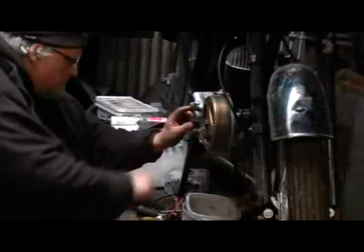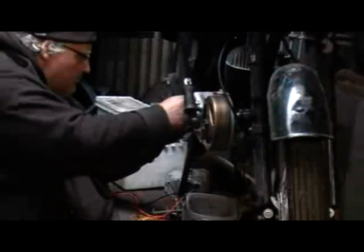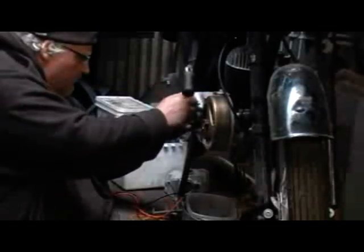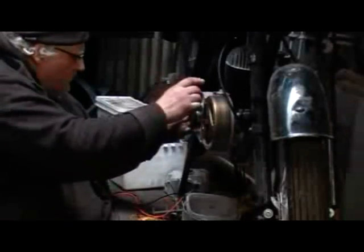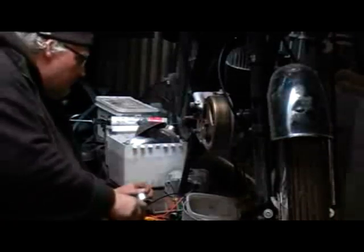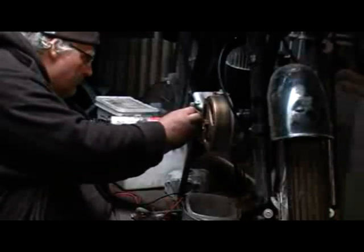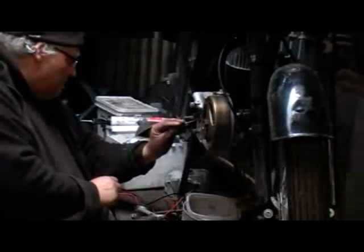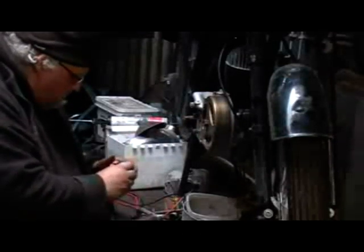That just leaves the kickstart spring. It's straightforward — you just put the spring in. There's a series of holes in the casing that the tang of the spring can go into. Usually just start at the one nearest the top, line it up with the kickstart, put it on its splines and see if there's enough pressure in the spring to hold the kickstart against its detent. If not, you just work your way through the different holes available. I got to the point where I had to bring it to the lowest hole and bring the spring right through one full revolution — that can be a pain, but it does give enough tension to hold the kickstart forward.